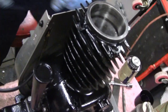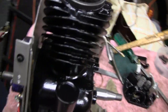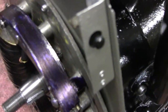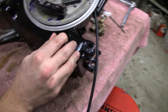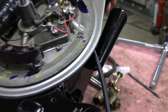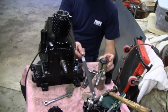You better watch where that thing is swinging. Richard's got the flywheel off — you can see the shiny parts up there, that's where it's rubbing. So you just got to clean it up a little bit with a file. The bottom's actually not too bad — it's only on the one end, just a little tiny spot right in the front. All right, we're getting there. Stay tuned.